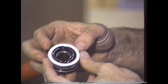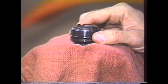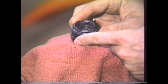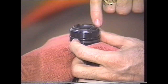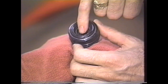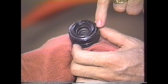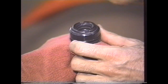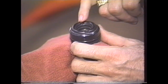If you want to get into the seal itself, this top-out bumper actually just pops out - pries out with a screwdriver. Now this is a typical KYB or Kayaba seal head assembly, which is a little bit trickier than the Showa. They've also added a top-out bumper, but they've peened over the edge of the seal head assembly to hold that in. You cannot get the metal plate that's on the other side of the top-out bumper out unless you un-peen this. It's a little bit tricky - use a big socket clamped in a vise and tap on the side of it with a plastic mallet. We have either rebuilt or brand-new seal head assemblies available at Racetech.